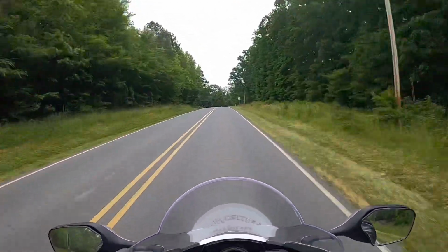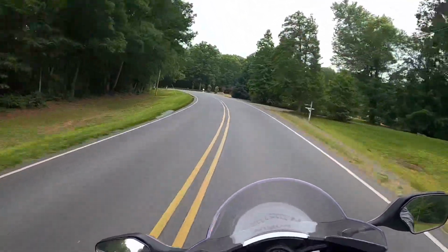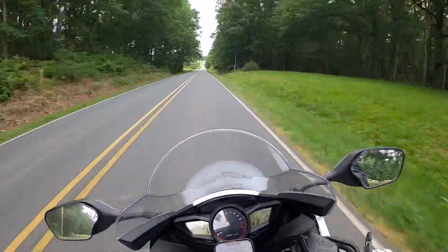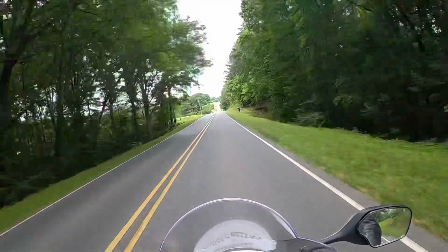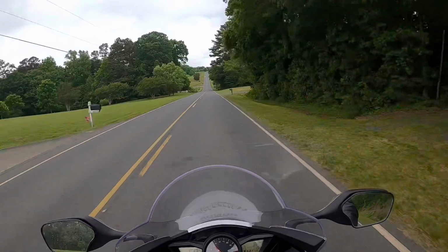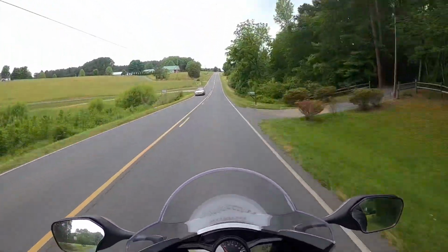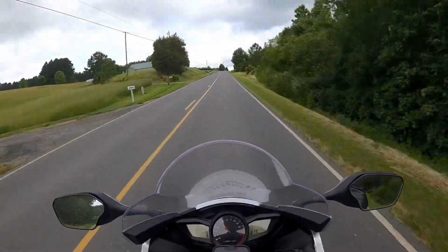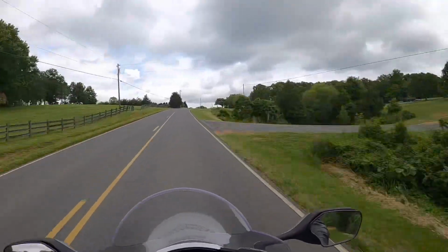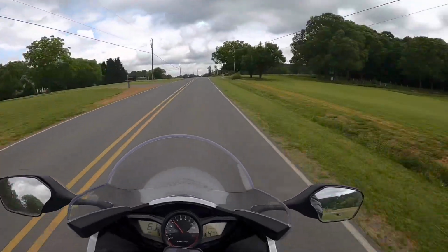But whenever you do put new tires on, even if it's the same model as you had before, you're still not used to them, especially if it's not the same kind of tire you had before. But even if it is, the profile is different because it's not as flat. The tire is much more rounded. It's brand new, right? The shape is different. The bike is going to turn in a little quicker, and you're not as used to it compared to what you just had. So I think that's the main thing, and that's for scrubbing it. So to get used to it,